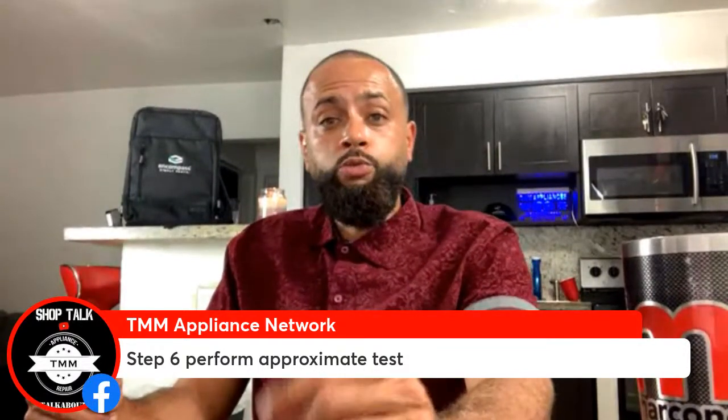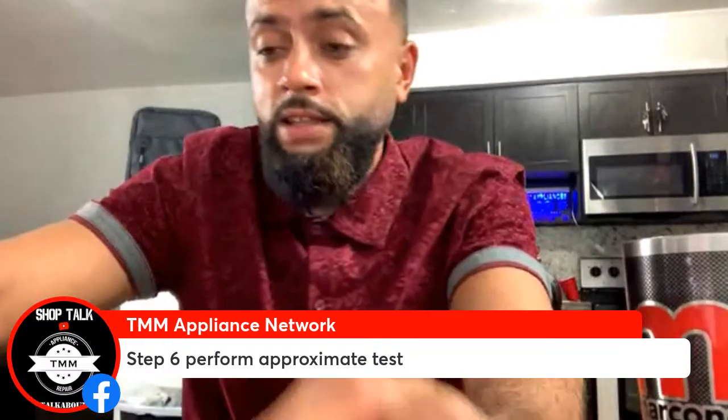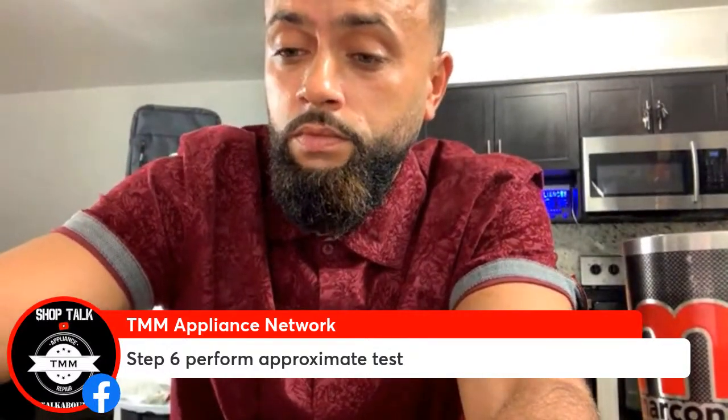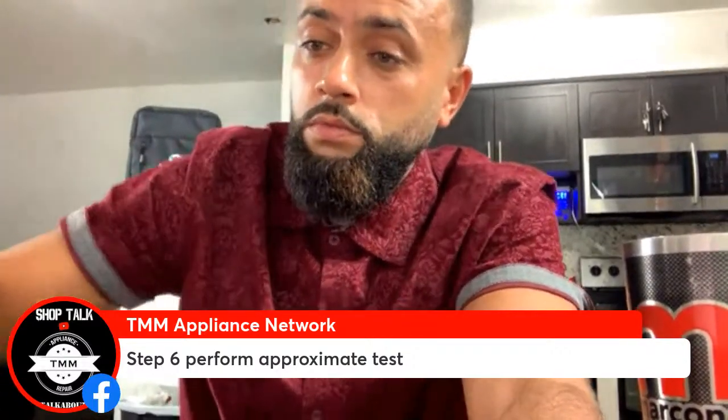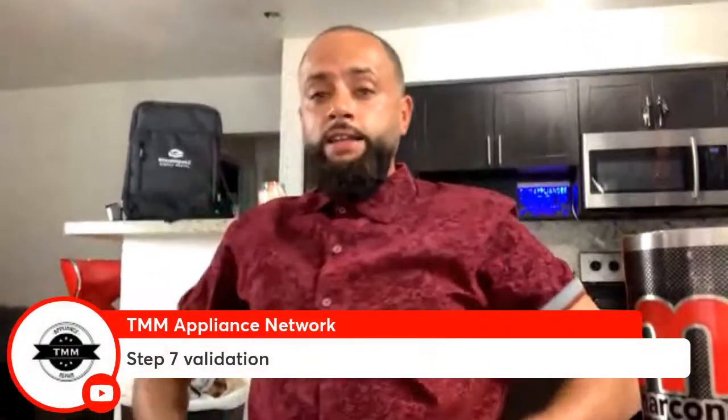Which brings us to the last step now. Final step. Validation. Step 7. What do I mean, validation? Very simple, y'all. From the board, you've done your test. Man, I'm getting output voltage. Let me disconnect the harness. Do an ohms test. Let me do an amp test. And it's not coming out right. We've identified the load, but it's not coming out right.